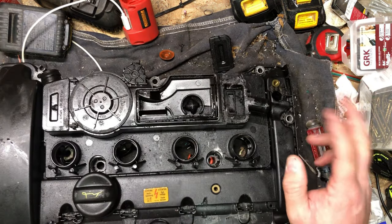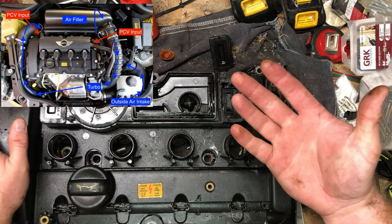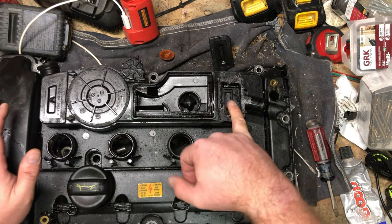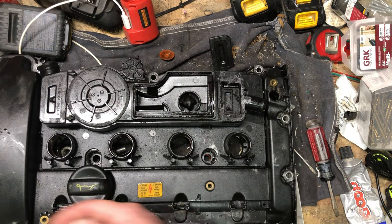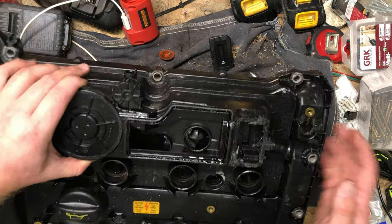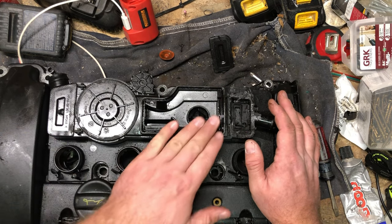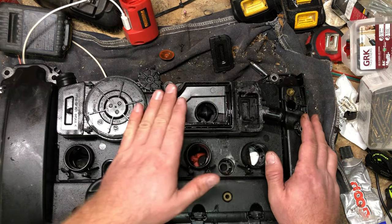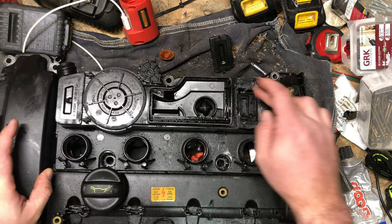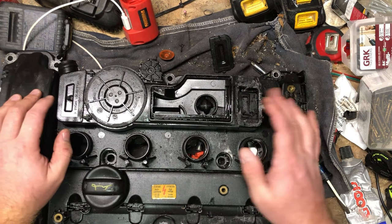That's going to be the low pressure side of the system. On this side we're hooked to just after the air filter. Anytime there is positive pressure in the crankcase, this valve is going to pop open, and the vacuum on the manifold side is going to pull that pressure through the turbocharger and through the intake loop back into the engine. What they're doing here with this whole setup is creating a space to trap oil. You notice that this whole surface is kind of tapered down, so any oil that gets caught in here is going to work its way back and flow back into the engine. They're trying to minimize the amount of oil that actually goes out of the PCV valve - that's kind of clever.